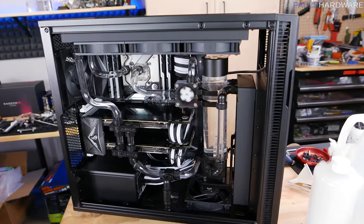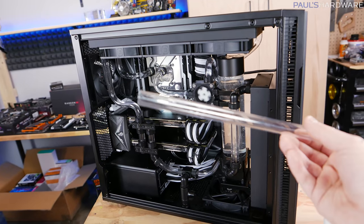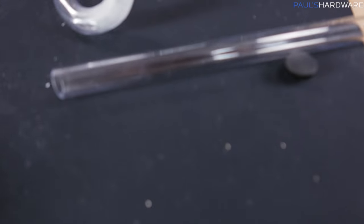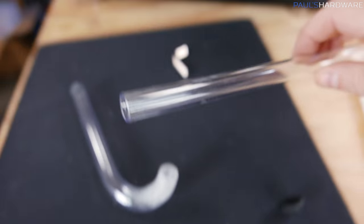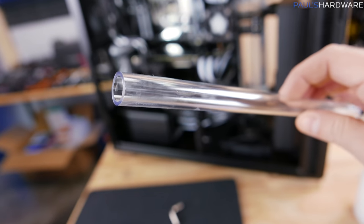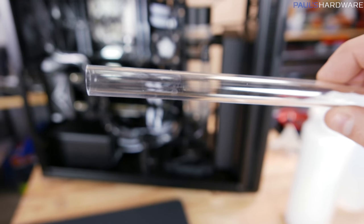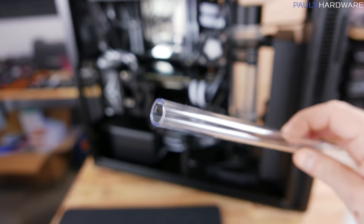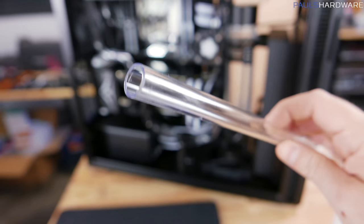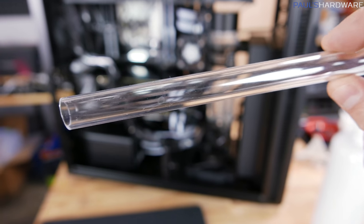I need to give a shout out to Richard, aka DarthBeavis. When it comes to bending this thicker stuff, the thicker 16mm PETG tubing, it's just a bit more challenging. You have to warm up a bit more of it and everything. And just actually watching him do it, just as far as how aggressive he is with getting the heat on there, as long as you're careful, of course, to avoid bubbles and everything, was super helpful. So thanks, Richard, for that video on that. I'll post a link to that one in the description.